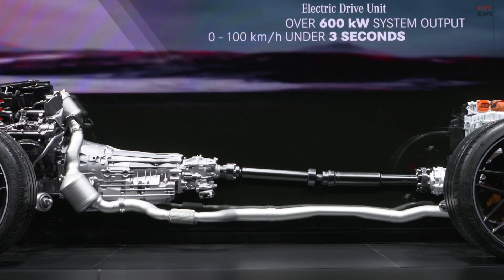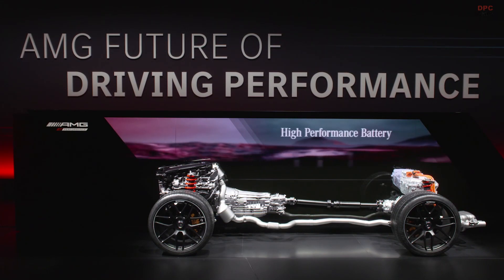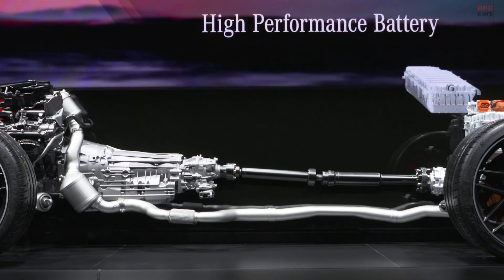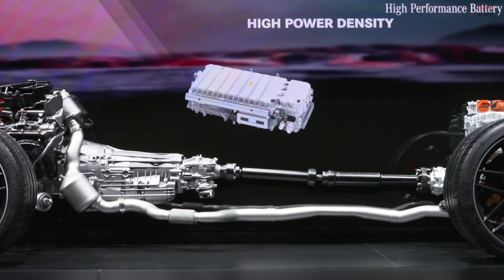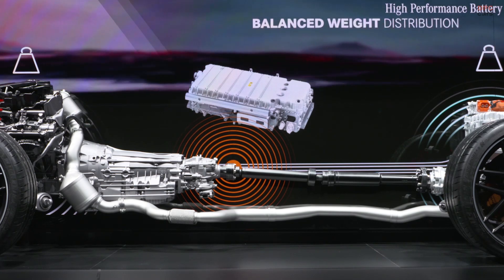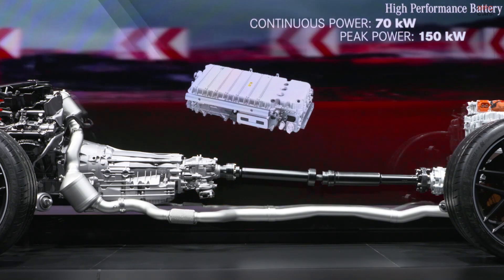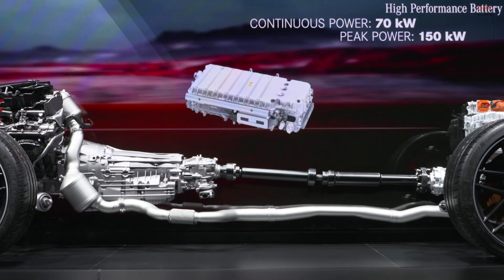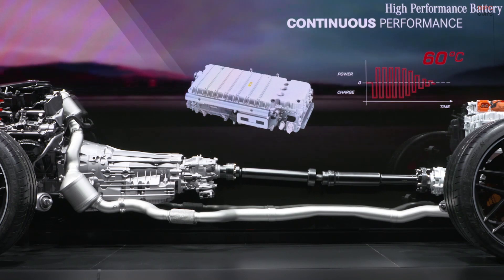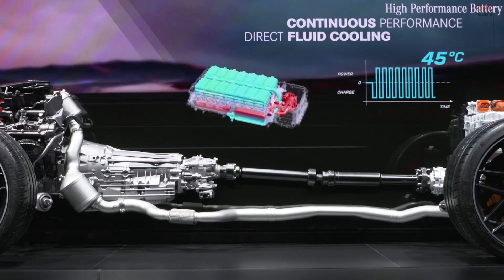We made this effort for a good reason. Batteries for performance vehicles and sports cars have to meet very specific requirements. One of them is the high power that you can shift in and out of the battery repeatedly. This is a key feature of our high-performance lithium-ion battery, developed by our engineers in Affalterbach in close cooperation with their colleagues of the Mercedes-AMG Petronas Formula 1 team. Technically, it is closely related to the energy storage systems that have proven reliable for years in our Formula 1 racing cars. The power density is twice as high as that of a conventional battery.